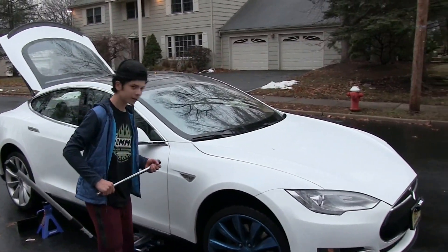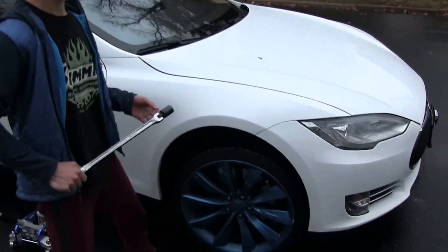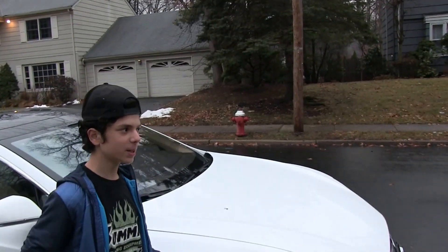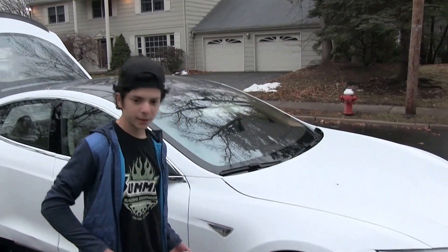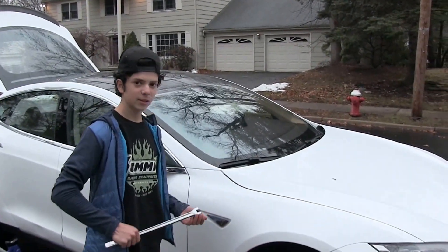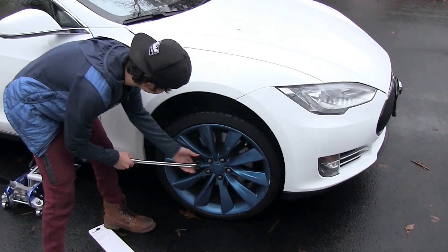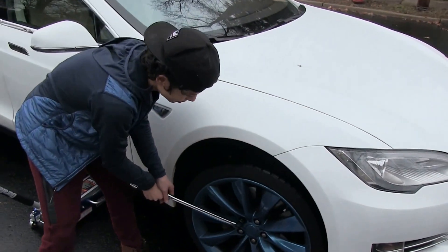So I made a pretty big mistake. I jacked the car without breaking the lug nuts on the wheel first. A lot of mechanic shops over-tighten the bolts with an air gun, so they're very tight, and if you try to unscrew them while the tire's in the air, it would just spin. Now I have the car back on the ground — gonna stick my breaker bar in there and break these nuts loose.